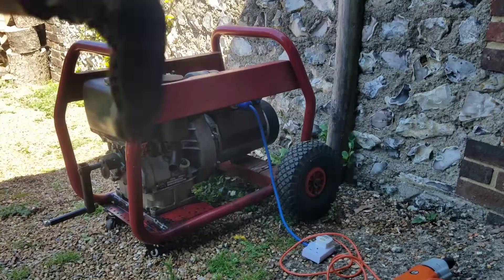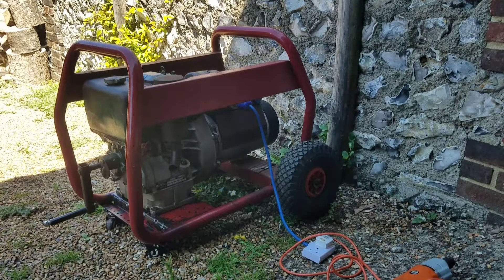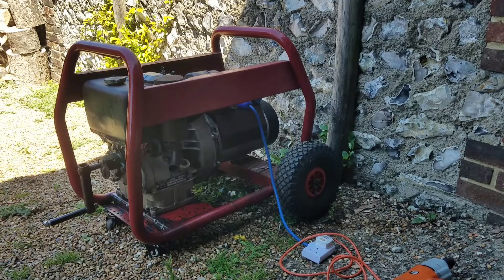Let's try and get it running. When I start cranking it you should be able to hear a little squeaking sound after a couple of revolutions - that's the fuel pump kicking in - so if we hear that we're halfway there. When it does start you won't be able to hear anything other than the engine because it's pretty loud, but it should go through a sort of self-stabilization where the revs will fluctuate up and down and then stabilize. Let's give it a go.